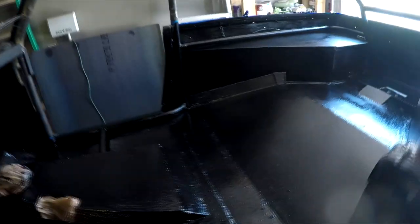There we go — that was the process. You saw me scuff up the interior to give the paint something good to adhere to, do the seam sealer throughout all the edges, and then Jess and I rolled on the Monster Liner. This is actually the first thing Jess has really helped with on the Jeep — she normally doesn't like the loud noises in the garage, but she came out to help paint and we bedlined the entire interior using the roll-on Monster Liner kit. Super easy kit and it turned out really good. Next step is making seat mounts, getting the new Corbeau seats set up, hanging the fuel cell, and a few more interior things before we move on to Bondo and bodywork on the outside.